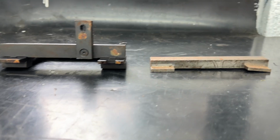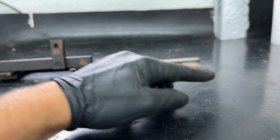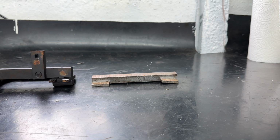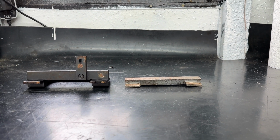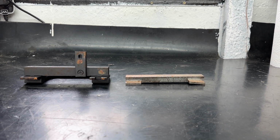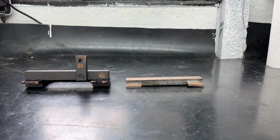Now if you look down at this height, you can see that these two are dead level, and on this one you've got a slight advance on the inlet cam. As mine was timed with this previously, this will be the tool that we need to reinsert and reuse again for getting the best out of it. Like I say, a compromise for a little bit of low RPM idle power, up top gaining the screamer. So yeah, we'll go over to the car now, bang this in, and this should drop straight into the camshafts.